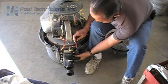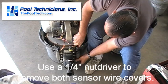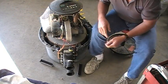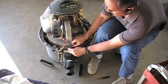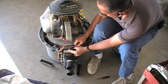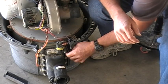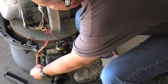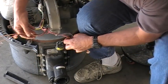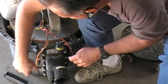We'll start by taking the covers off for the electrical. The wires on these are real nice — the wire harness comes out and you really don't even need to mark the wires. Just be careful not to tug on the pressure switch; wiggle these crimp connectors when you pull them off to avoid them getting corroded and breaking. That whole wire harness is off and ready to go. It's pretty clear which one goes to which side — your pressure switch, your sensors, temp sensors, high limits.